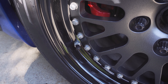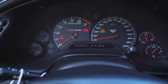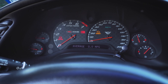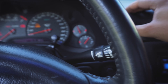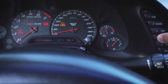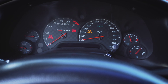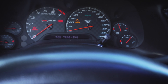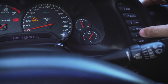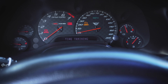Let's go ahead and hop in. Here we are inside the car — I just put the key in the on position with the e-brake set. To relearn the tire pressure monitor system, once you have the car on and you're on the menu, you want to hit the Option button and keep going until there is no message displayed. Once there's no message, hold the Reset button. Now it says FOB training — that's for key fob training. Then hit Option again to go through the options until you get to Tire Training.